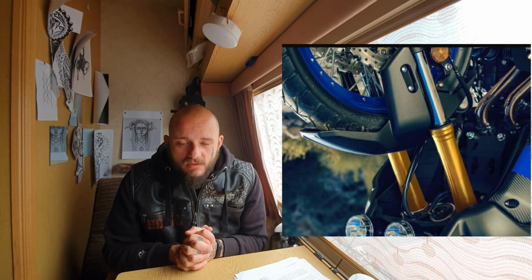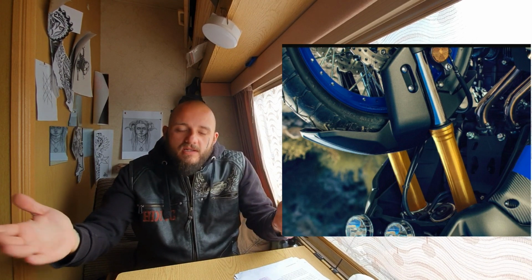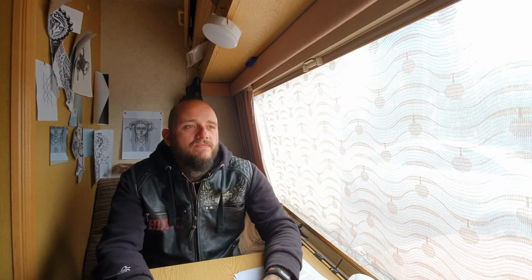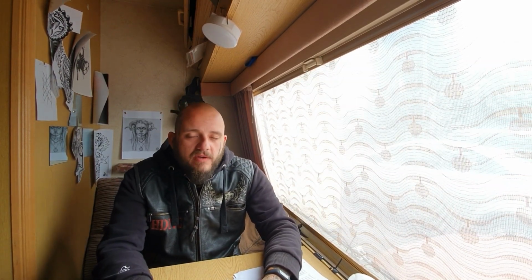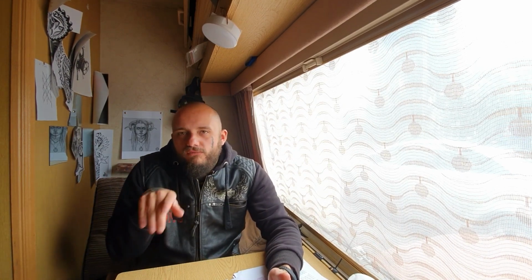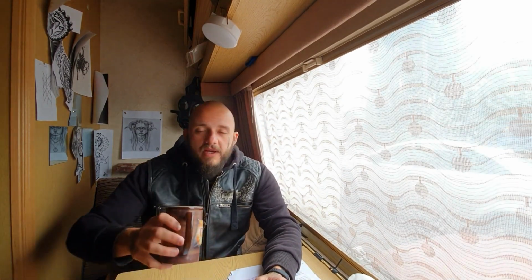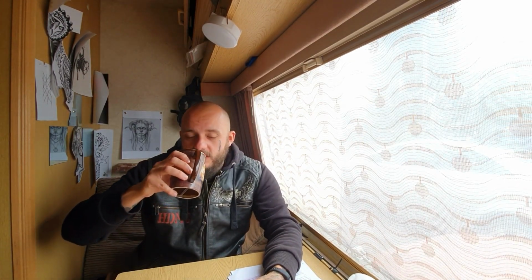That type of suspension I think is good the right way up, because if your seal's gone a bit, you can wrap some paper around under your dust seal to make it last way longer. And even if it's completely gone and you haven't wrapped paper around, when you pump your suspension you can get a little oil coming out, and it doesn't just dump out like you would if they were upside down.